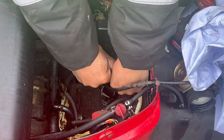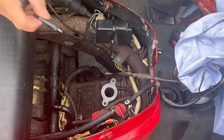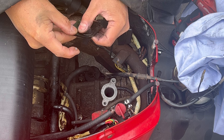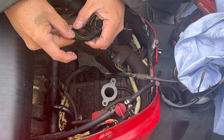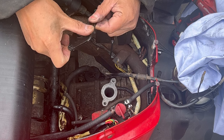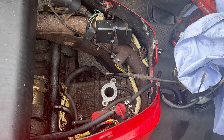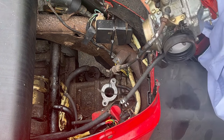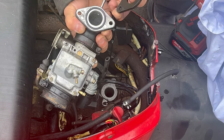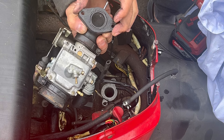Just the connection there, connection there. Here is the gasket plate with the O-ring on it. It doesn't feel completely flush in all areas — it's pushed in a little more here and there. When you have it on, it's pretty tight. However, there's no real gasket that connects this flat surface to that. Should you not have a gasket? I think you should. Looking at the surface, there's a rubber gasket there, so the rubber gasket part goes to the smooth surface.